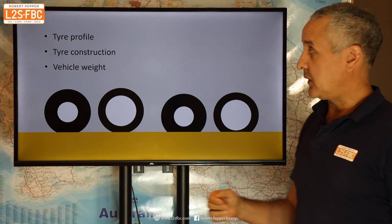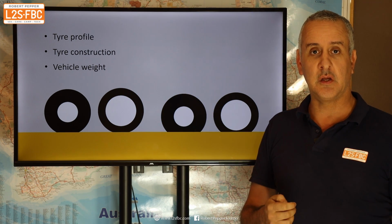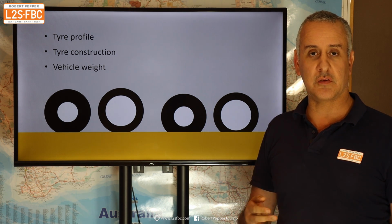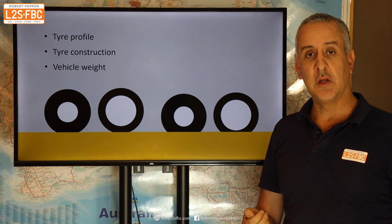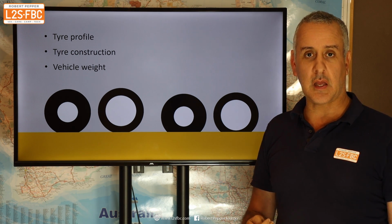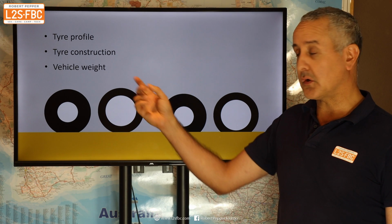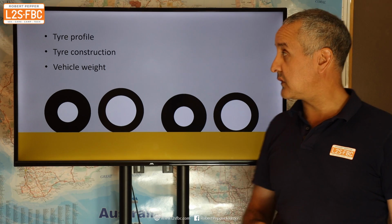Okay, now what affects it? Well, tyre profile, tyre construction. If you've got a passenger construction tyre, that doesn't have the quite fixed steel sidewall beltings and plies. It doesn't have that sort of construction of a light truck construction tyre. So you typically find that the passenger tyres air down quite nicely. That's one of the reasons they tend to go quite well in sand. And vehicle weight makes a big difference. Well, obviously, the heavier the vehicle, the more it sinks in.